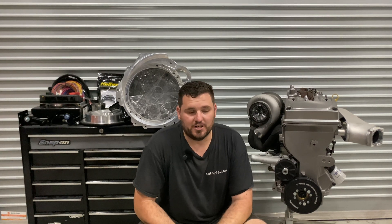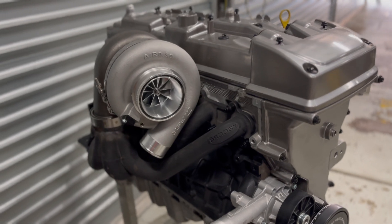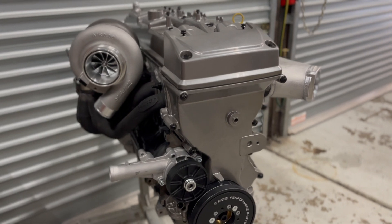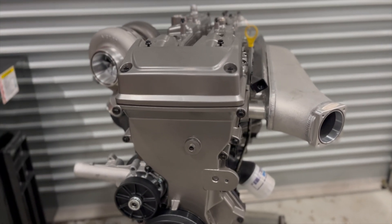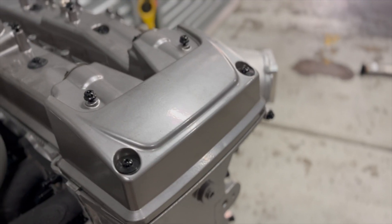Alright, let's get down to the nitty-gritty. We're starting with a Barra. This thing's been built reasonably well. It is a stock gas bottom end - pistons and rods - but it has Kelford 218B cams in it, Atomic gear, timing chain, all bits and pieces. Our previous video on this actually goes through everything that's in this motor.